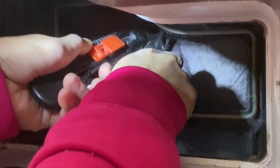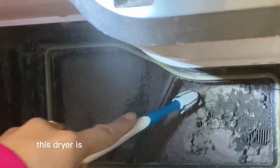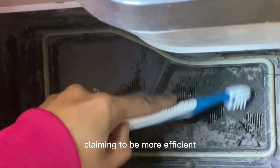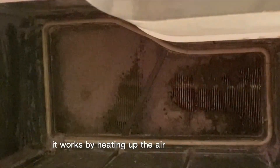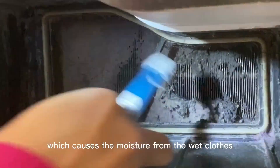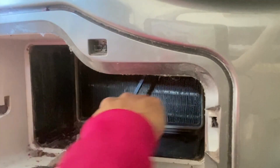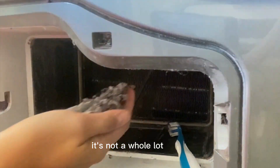The lint stank because it was wet and moldy. This dryer is the Whirlpool Hybrid Care ventless dryer — a dryer without a vent, claiming to be more efficient than a traditional dryer. It works by heating up the air inside, which causes moisture from the wet clothes to evaporate. That evaporated moisture is then cooled and condensed back into water, which is collected in a container at the bottom of the dryer.